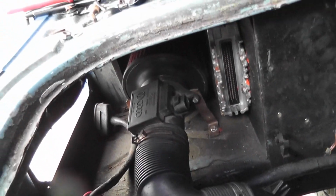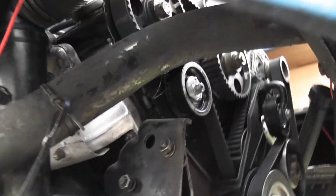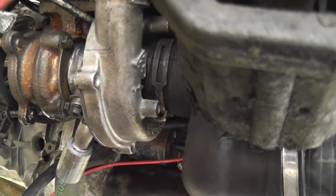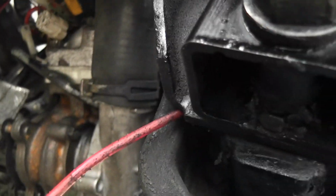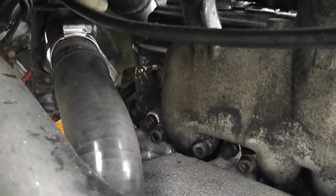So you can see our air filter and MAF sensor there. They go off to the original elbow fitting here. And then we've our crankcase breather going over to here, and it comes down to the turbo underneath. So that's this lad here, and we made up a joiner there, and it goes onto that kind of cranked piece there and into the turbo inlet. Then the turbo outlet comes from here and goes via a silicone duct up along there.